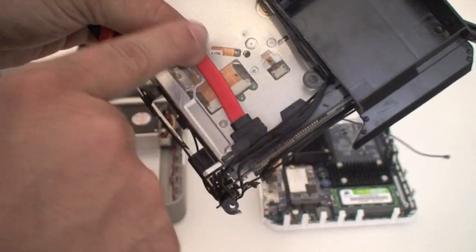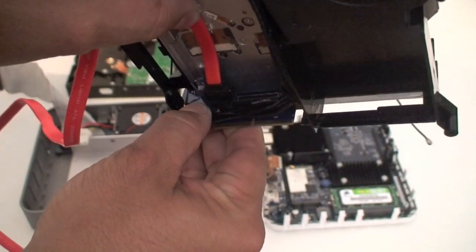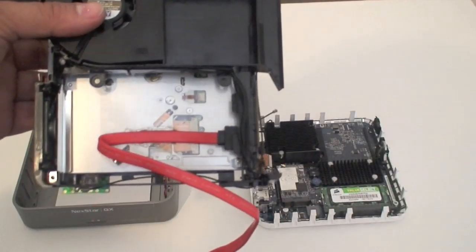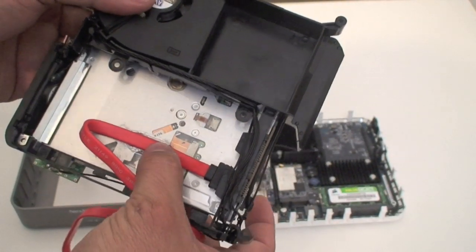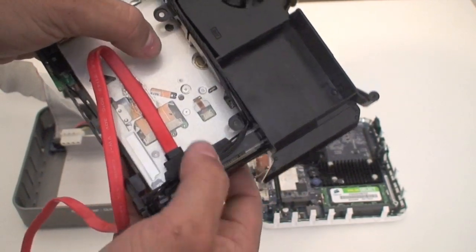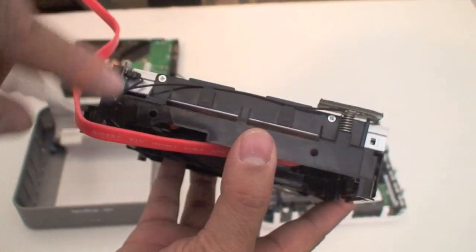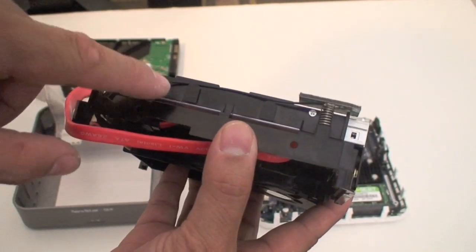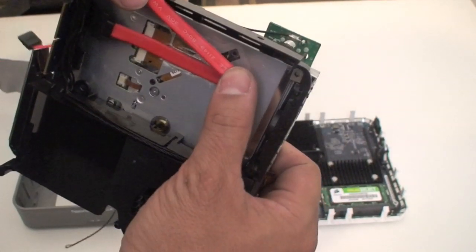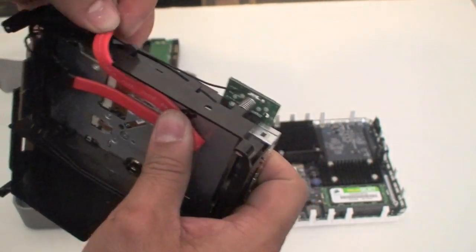Once I glued it in place, it pushes the cable inward so it is always pushing the connection side firmly in — it will actually look like that. Now I am going to fold the cable a little bit in the corner. If you look here, there is a little cut on the Mac Mini on the top, and we are going to take advantage of this little slot so that we can run the cable right through there. Make sure it is nice and folded and then put it right through this slot.